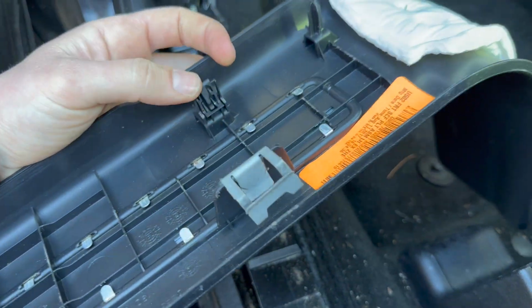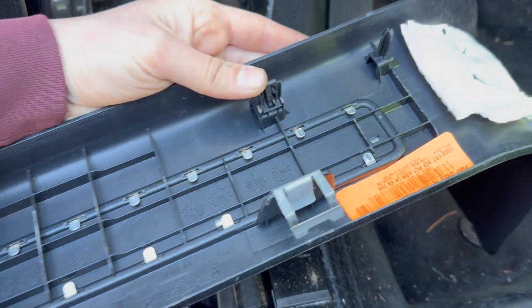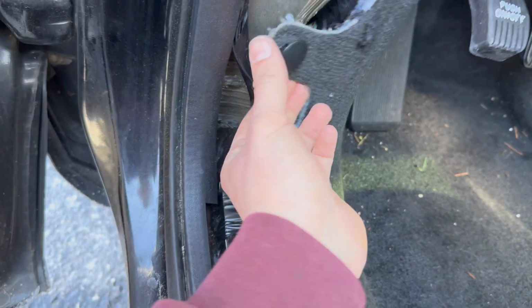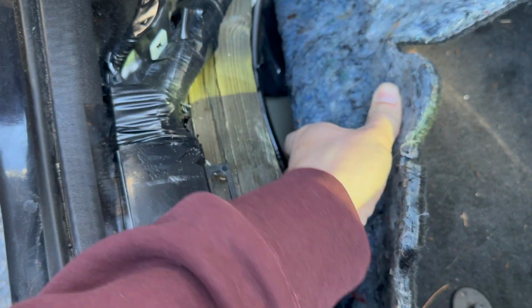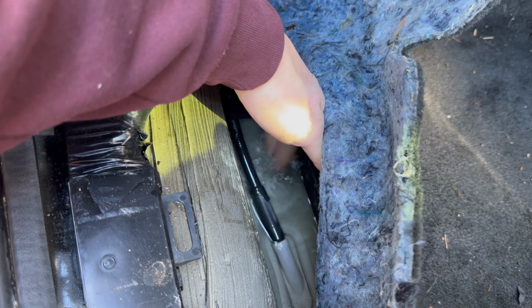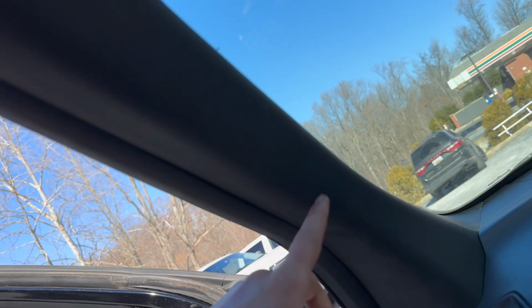It pops out on the clips. Has about 3 clips, 4, 5. And then I popped out this already because anyway I found where is the water leak. And if you look at this, you can see the water. Take this cover off. So you definitely want to take this cover off too, because here is the hose coming into it, and it's the draining.